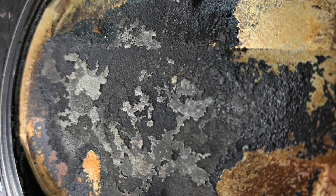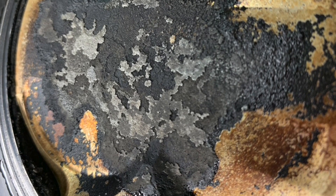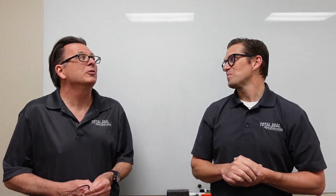This is the key. I've seen oil rings in different applications literally lose half their tension — I've seen it — in a very short period of time. Amazingly, a beautifully dry engine to a sopping wet engine. And as Lake just said, that oil is going to pull the octane rating down. We're into detonation, and for something as simple as this, you just destroyed an engine. And even if you have a modern engine with engine management and knock sensors, it's just going to keep backing off the timing — you're giving up performance, getting more fuel wash, wearing the bore out. I've seen some nasty pistons coming out of an engine that had lost half that tension and it hadn't burned a hole in it — but those pistons were ugly. It wasn't there yet, but it was certainly on its way.